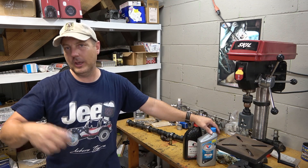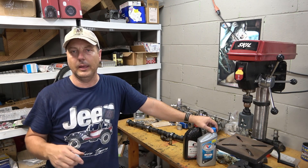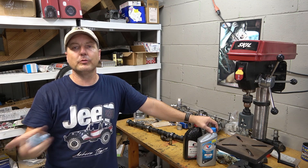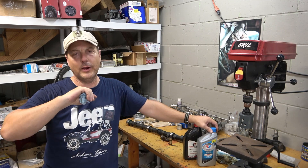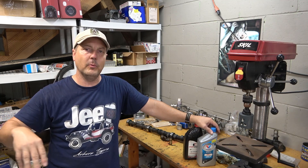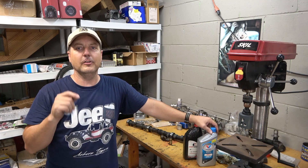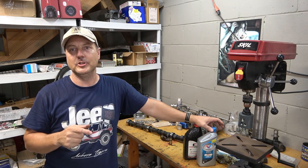So what happens if you run, say, standard Castrol 10W-30 in a Datsun 240Z? If the motor's never been rebuilt and it's all original components, you'll probably get away with it for a while. But let's say you just rebuilt the engine with a brand new Schneider camshaft and new rocker arms. You run some 30-weight oil with a break-in additive — most break-ins have some zinc in it — do your flush, then put in standard Castrol 10W-30. I can tell you from direct experience: very quickly you're going to start wiping the cam lobes and damaging them because you don't have the zinc.